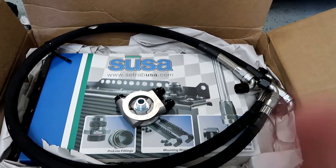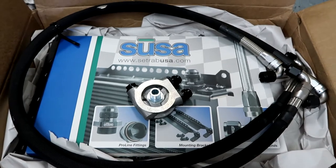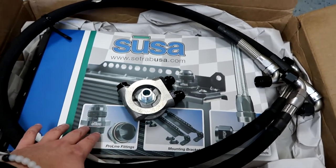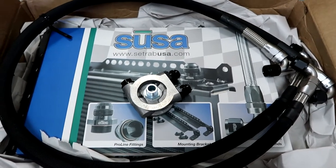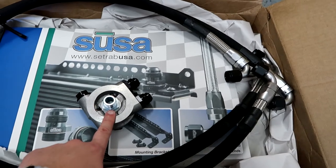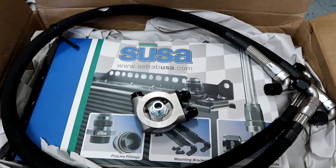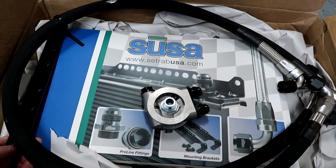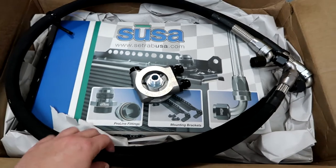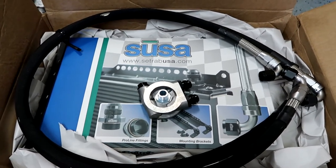Here's what actually comes with the kit - there's really not that much to it. It's essentially the oil cooler itself, which I went with the 19-row from Z1 Performance. They actually offer three variants: 19-row, 25, and 34. I went with the smaller one because I plan to pair this with an actual larger capacity oil pan. Then we have the oil filter, the sandwich adapter - I went with the thermostatic version because it is a street car. We have our bracket that mounts to the core support, and then our lines with an extra protective sleeve.